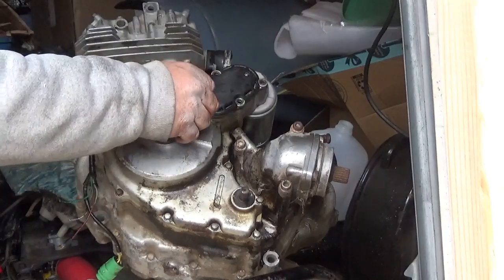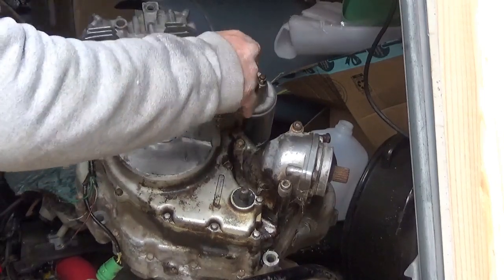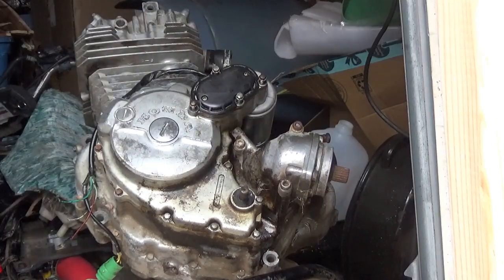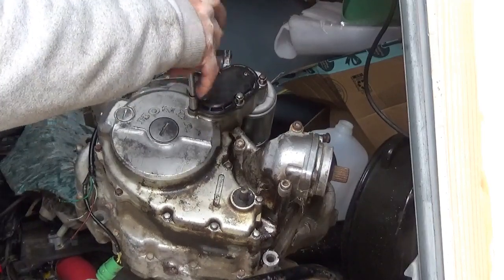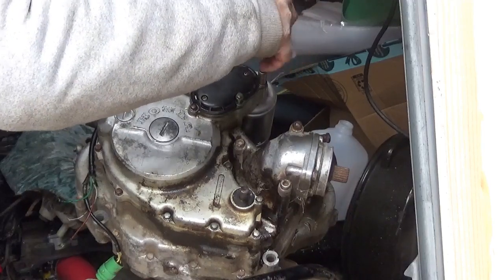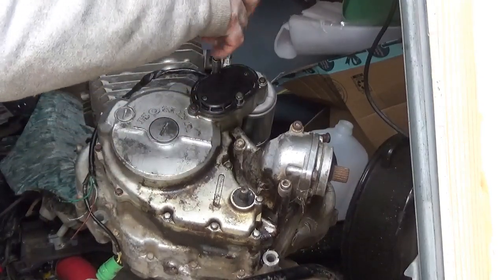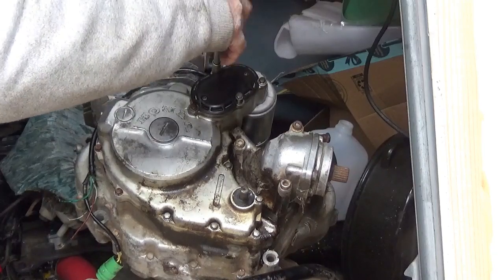Oops. Remember I mentioned putting those bolts in the wrong place. Two long ones. We're getting right up close to a compression test. You guys know when you tighten these things, you're really supposed to just bring them down to a little bit snug, go across. These two really should have been torqued in sequence with the cover bolts. So Harvey's bad for not doing it that way.